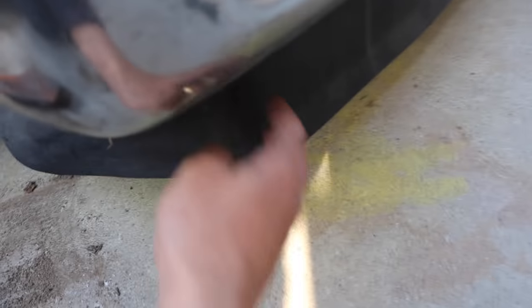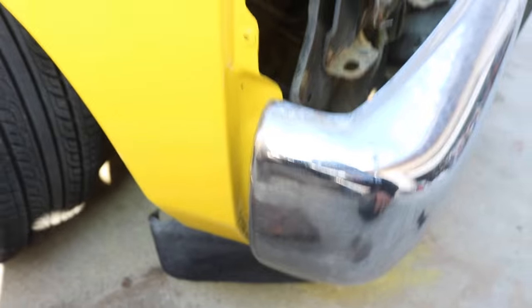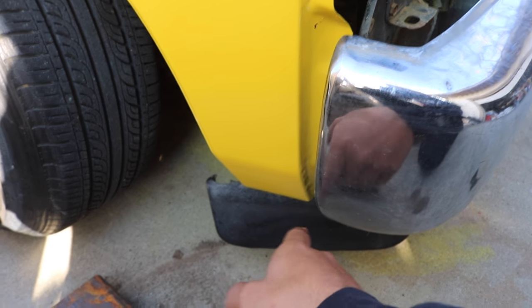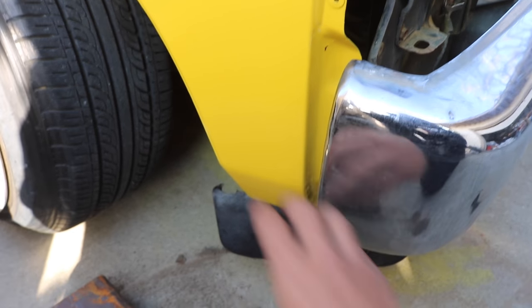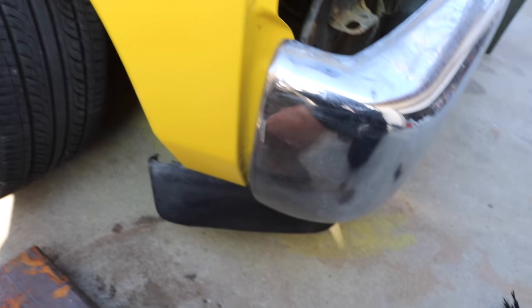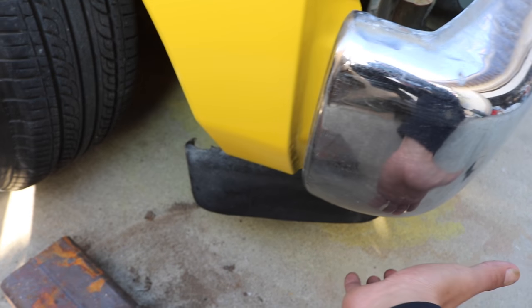In order to fasten the valence, I pushed it back to where it was hitting on the bumper and drilled a little hole. It is zip tied on the factory hole on the fenders — these are four by four Pathfinder fenders, but I believe even the stock two-wheel drive fenders have a hole, just in a slightly different area because of the way the valences are. I pushed it forward as much as I could so it would be flat, then drilled a hole so the lip can't fall back and give it that weird angle. The zip tie helps with flexing.